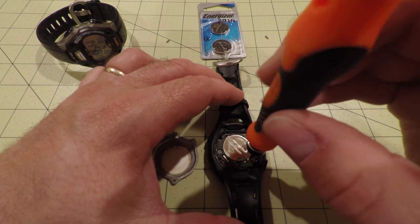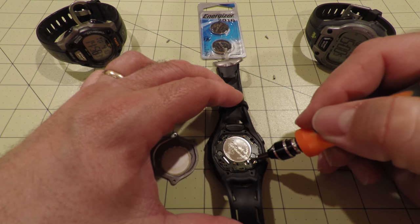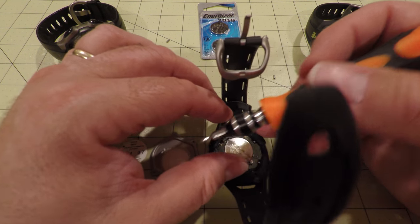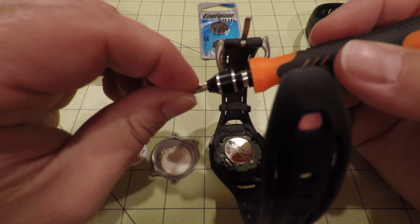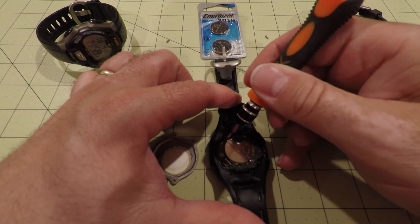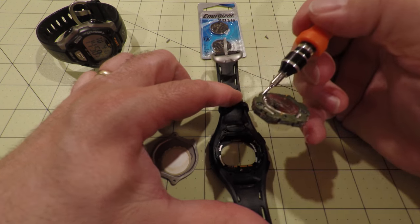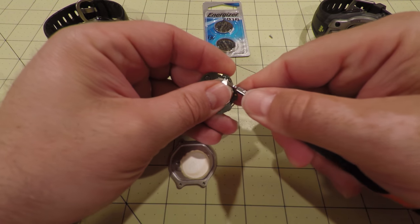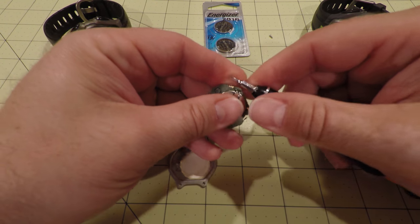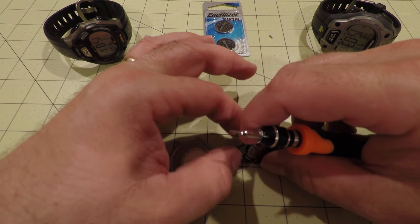As I tried to remove the screw on the latch, I discovered that my screwdriver was too big, so I changed the tip and put in a small flat blade. I tried to unlatch where it told me to in the upper left corner, and in doing so I accidentally removed the whole motherboard. With the whole watch out, I was then finally able to unlatch that little metal arm that sits over the watch, and once I did that, the battery just slid right out.